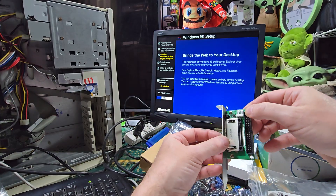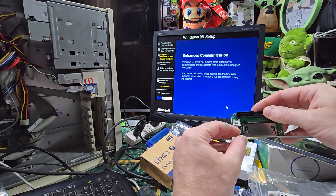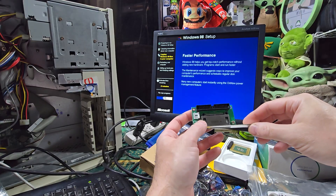So this is the other side — I think it must have a slave/master jumper, and it does. So I want to change this one to slave to make this my secondary drive.